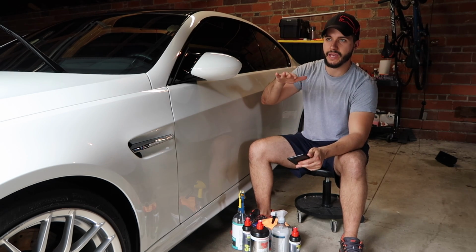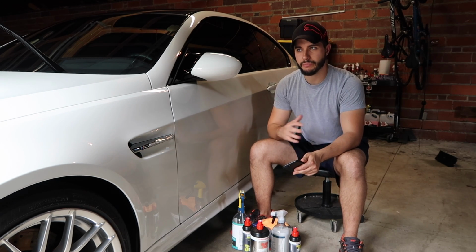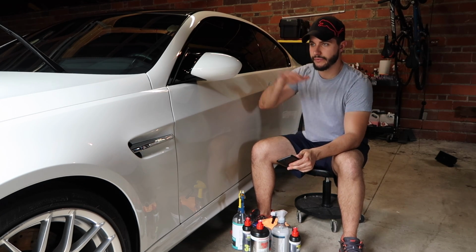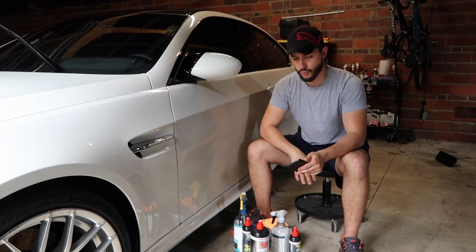If you wait till the end and then do CarPro Eraser, the polish or correction dust tends to bond to the paint, like in the cracks, quicker, and it's harder to get off. So definitely go panel by panel. When you're done, use this stuff and give it a final wipe down. It keeps it way cleaner.